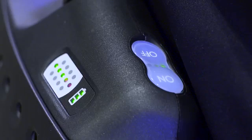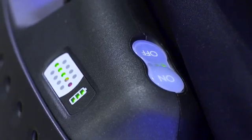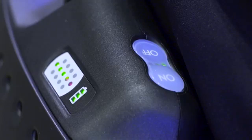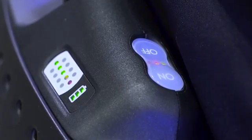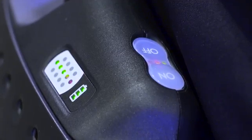When the second red light is seen, you will shortly get an audible alarm as the filter is so clogged that the airflow level cannot be maintained. If this alarm is ignored, the unit automatically turns off.